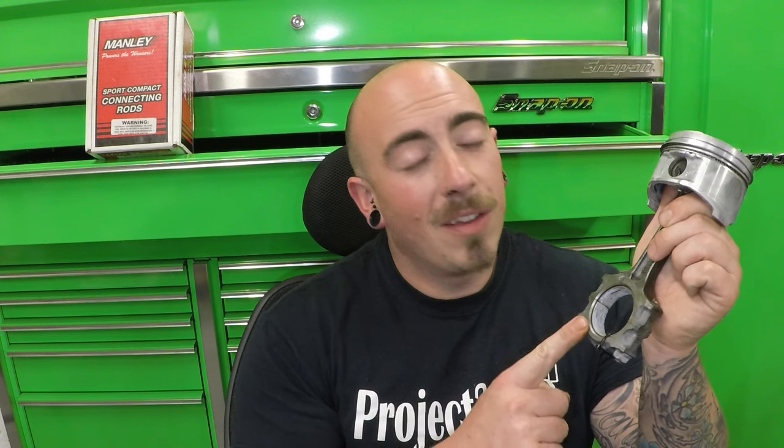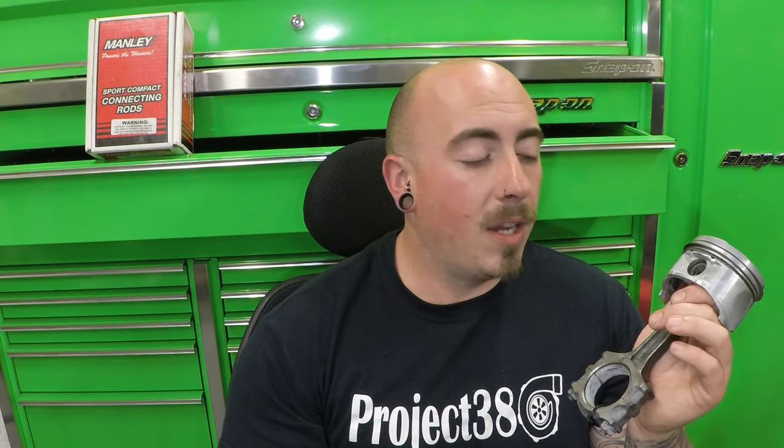So there are a few reasons why I took this engine out of the car and apart. One was I heard a knock from the bottom end, which I had to investigate. And two, because I was going turbo, I wanted to put a little bit of strength in the bottom end. So I wanted to replace the standard rods, as I've seen it happen to five of my engines now, and with maybe twice the power, it's probably going to happen again if I keep these stock rods in. And all they like doing is bending under pressure, particularly the low torque side of the engine.